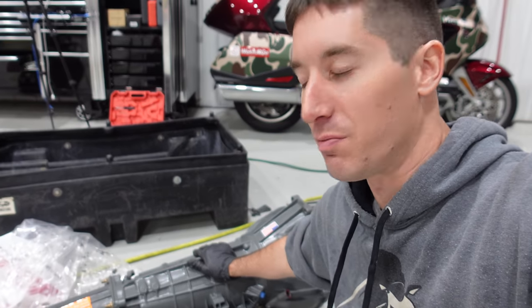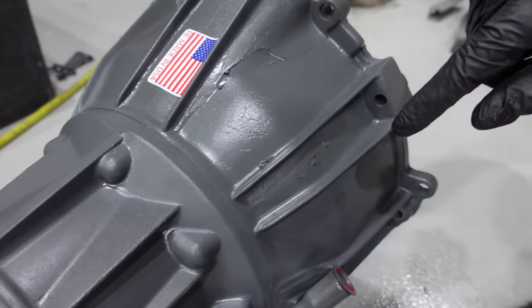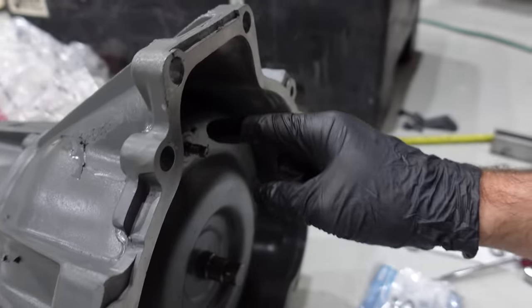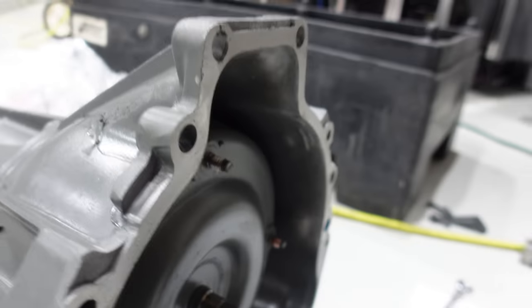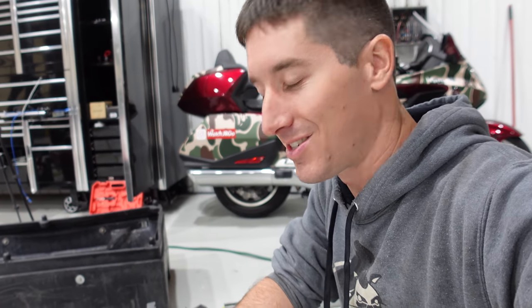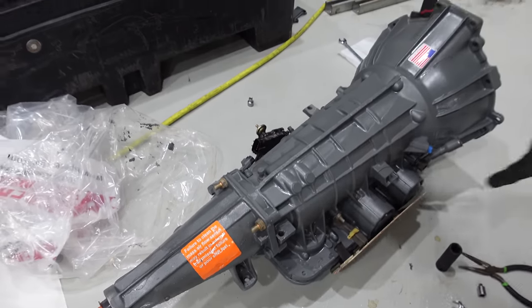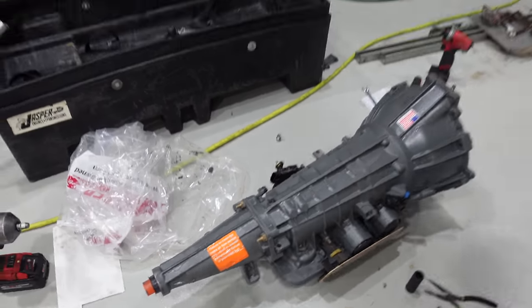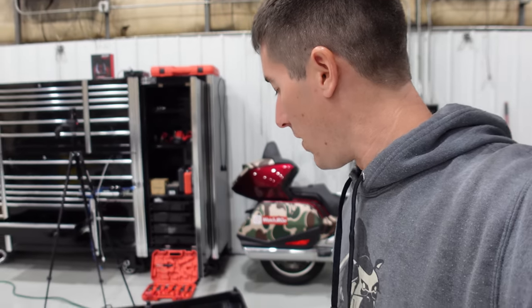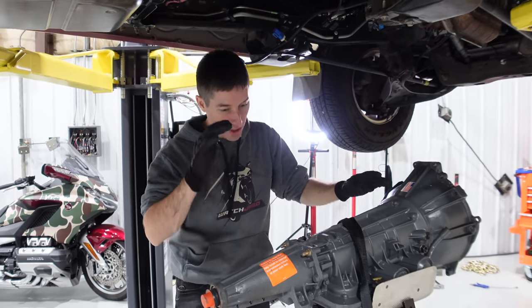And even better, I think they took a gallon of paint and just poured it on this — you can just take a look at the paint job there. They did that to the converter too. So I had to chase the threads on the converter studs because there's no way to get those nuts on. Luckily they send you new nuts so you can ruin the old ones chasing those threads. The upper bell housing bolts are supposed to have a bracket on them and they put a bolt in there instead of the bracket, so we had to bring those over from the other transmission. Also they were covered in paint, so you'd have to chase those threads too. And the screws into the prindle, those had to be chased. Anyway, I'm tired of chasing threads. We have the new transmission all set up and ready to go on.